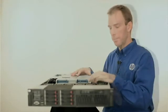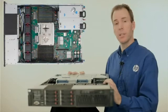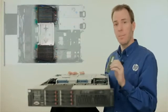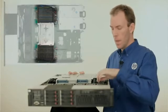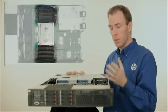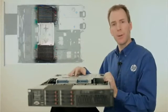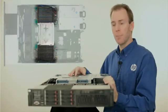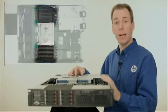Let's take a look at the memory subsection. To help virtualization workloads, we've greatly expanded the amount of memory capacity that this G7 server has. In this server, we support up to 24 DIMMs, meaning you can reach capacities of up to 256 gigabytes. With DDR3 memory, we're offering registered DDR3, which gives you that scalable high-capacity memory, or unbuffered DDR3 for its lower price point. There are even low-powered DIMM options so you can focus on power efficiency if that's your metric.